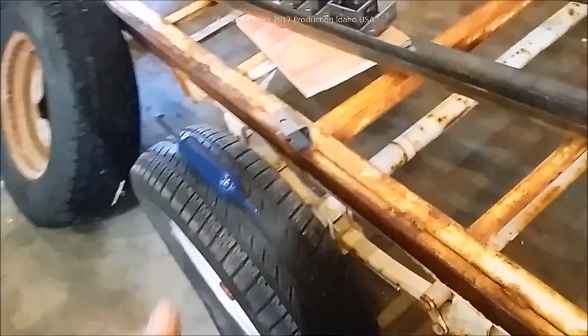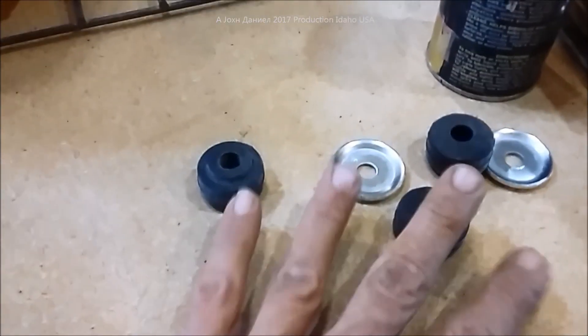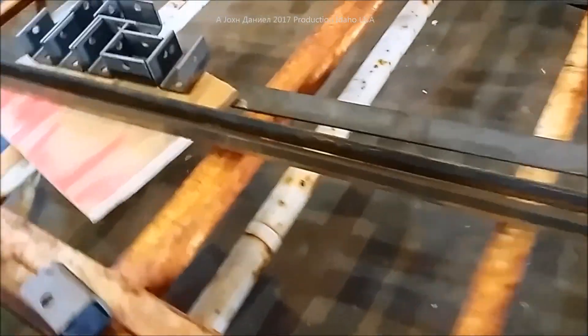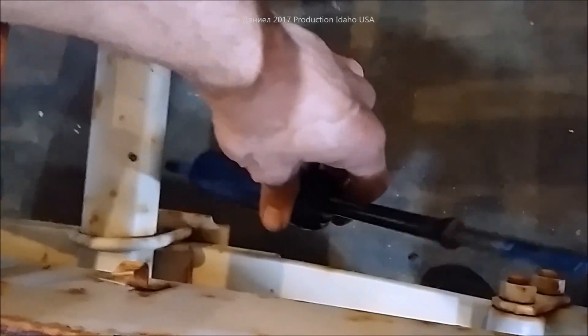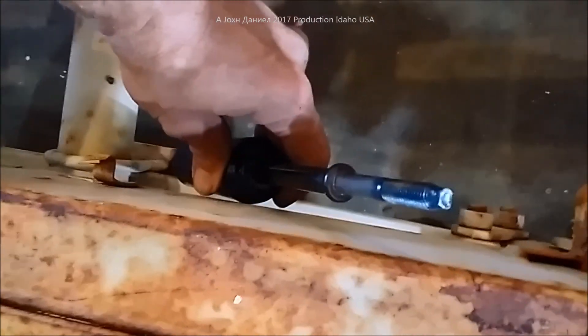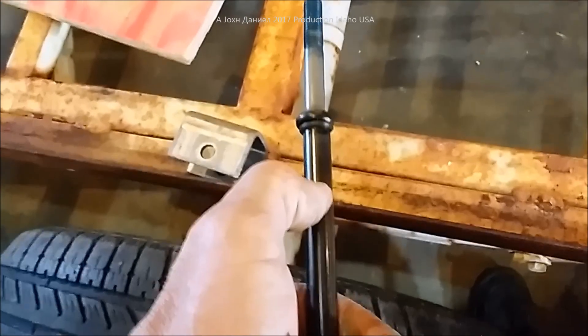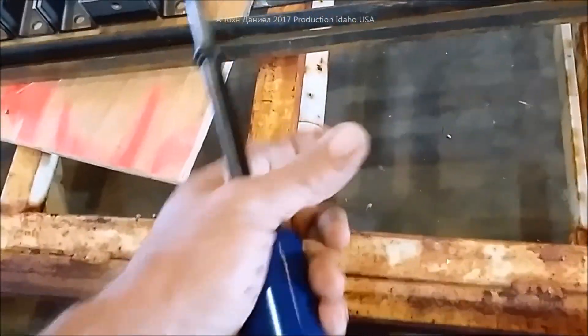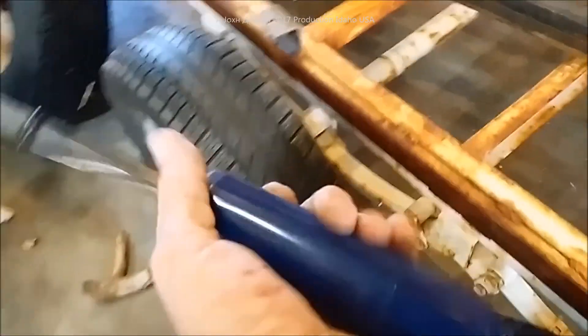Here is the box it comes in — a gas-charged shock absorber — and here's the hardware that comes with it. It's going to be an easy mount, with plenty of room. As you can see, it goes down and touches the U-bolt carrier for the axle with plenty of space. I'll compress it by one-third of the way during the install so it has plenty of travel, and since it's topped out with no weight currently, that'll be perfect for this trailer.